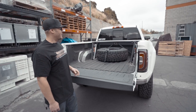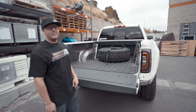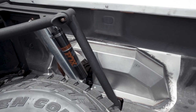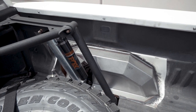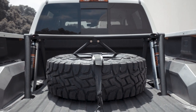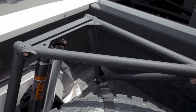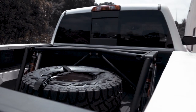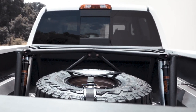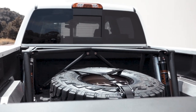In the bed, we went ahead and cut out the factory bed liner. We installed our oversized rear wheel wells and welded up our four locating tabs for the bed cage to the frame. We did a Fox 3.0x16 triple bypass, and finished it off by doing a full-size 37-inch flat spare in the bed, strapped in with our Dirt King three-way strap. That pretty much sums up the back of the truck, and that's a complete build.